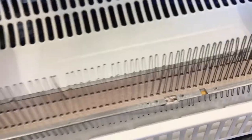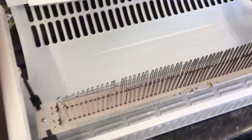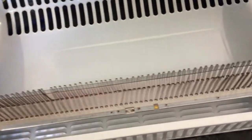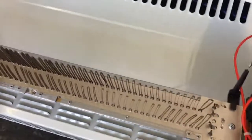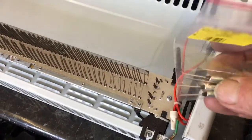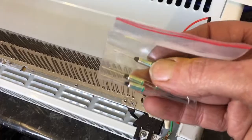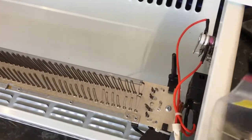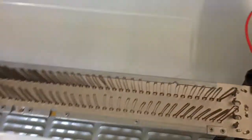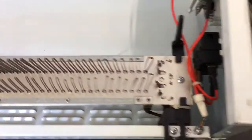This resets itself, so I've tested this and indeed it has reset itself and it works okay now. On the larger ones they seem to use these thermal cutout fuses, which are a very cheap item — in fact they only cost about 30p each. Of course you're going to have to charge labour to do this, but that's the general idea.